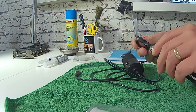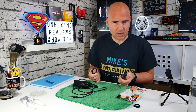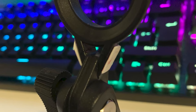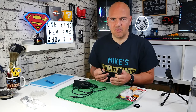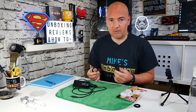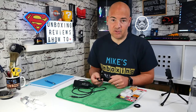It is actually quite a weak point in the plastic, and I have actually tried to already glue this with traditional superglue. I actually did put some kind of support bits on the side made out of a credit card, just to try and give it some sort of bond. But unfortunately it stuck for a little bit, and as soon as I tried to adjust the microphone, it snapped straight off. Superglue is a pretty hard glue and it doesn't have any flexibility — it doesn't like being bent or moved. Because plastics do tend to move, you really need to use some kind of bond with a little bit of flexibility just to give it a bit of a chance.